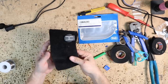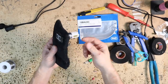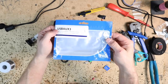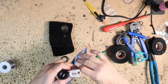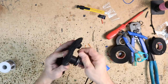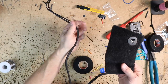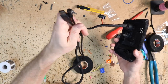We don't just want the USB hanging out looking all crappy. This is the passenger-side panel in the back that had the one big torx screw and the cigarette lighter — it unscrews and is actually one of the easiest ones to get out. What we're going to put in its place is the USB AUX3. It screws in similarly and has a little door that goes over it. We'll pull that door off and put his old cigarette lighter and cover in a bag to give to him. Just feed it through the hole, screw it in place, and now we have an AUX and a USB mounted flush in the same location. Run this up behind the radio and make sure you leave some slack down by the end so you can remove this panel and set it aside.